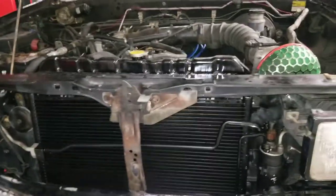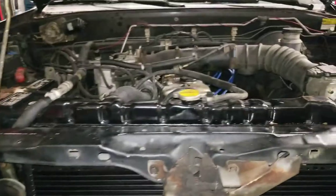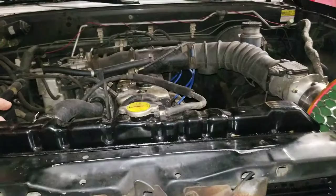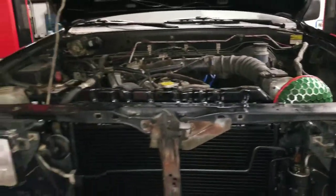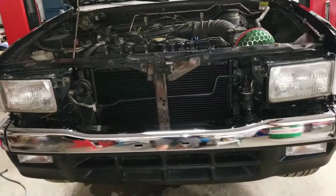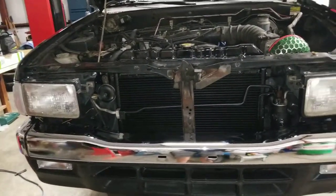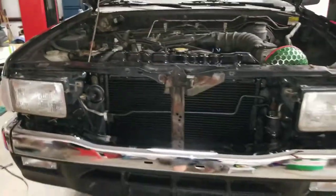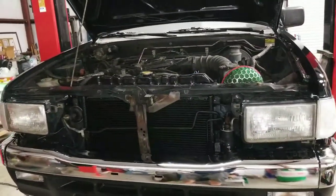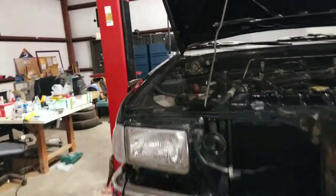For the most part all the trucks are the same with just some minor differences. For example, Japanese trucks usually had a copper or brass-type radiator, whereas the Indiana trucks usually had plastic and aluminum radiators. There were also a couple different rear ends — a lot of the Indiana trucks had a Saginaw-type rear end, while most Japanese trucks had a banjo-type, geared the same but made differently. There are several other differences, but I just wanted to clear that up.